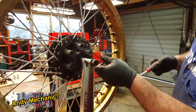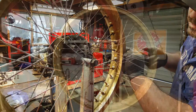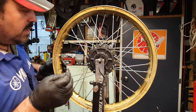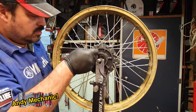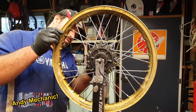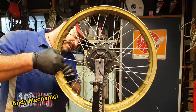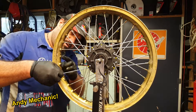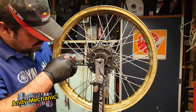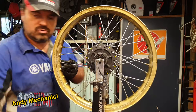Cool. So next batch of four, and take off the old nipples. Okay, so we can install the last four now. So we've got the yellow marks. Now that's the inner spokes, so we can put those in. There's one. And the last one of those to go in is that one there. And we've got to cross them over. There we go. Now this one, there's his buddy. Comes down to here, so 1, 2, 3, 4, that goes into there. So a bit of thread lock required. And a nipple, I'll screw that in there, screwdriver.